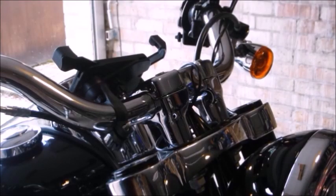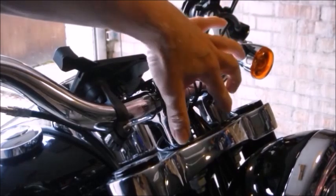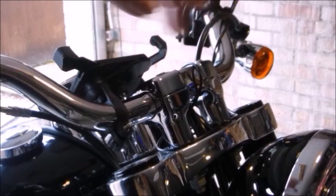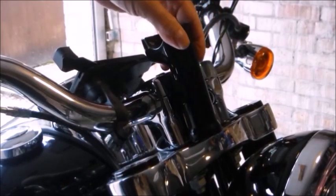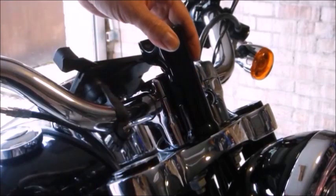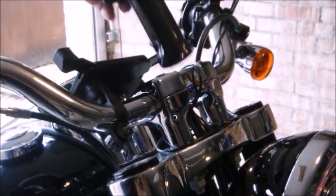Ever since I've had the bike, I've been thinking of raising the bars up a bit. I really want them bringing in a little bit closer to me, only by about an inch. Obviously there's lots of risers on the market — Harley ones, four inch riser to bring it back, slightly curved to bring it back. They're 200 UK pounds, which is absolutely ridiculous. A good friend of mine has given me his pair of four inch risers that came off of a Fat Bob. So it only lifts it up a little bit more, basically two inches more. Because of the angle of the forks it will bring it back a slight bit. They're black instead of chrome, but I'm going to use these for the moment to fit and decide if that's the right rise and pull-back that I need.